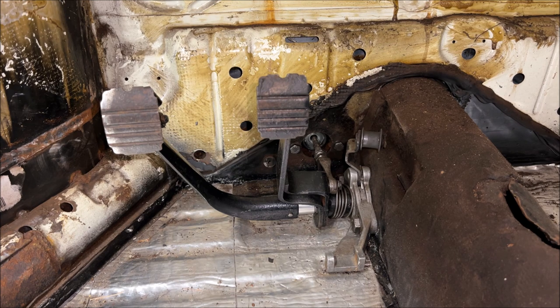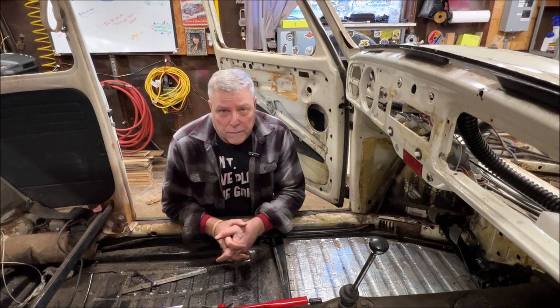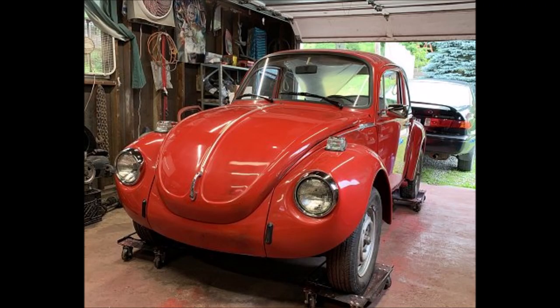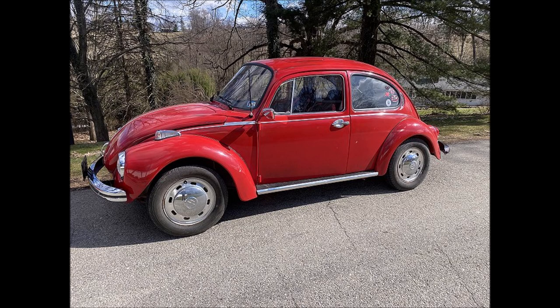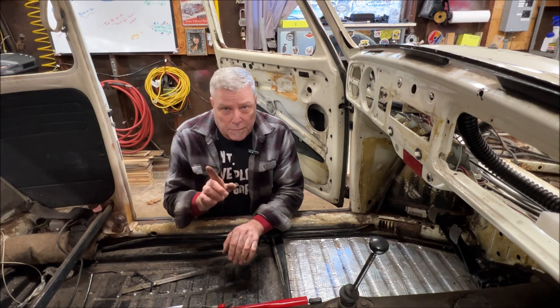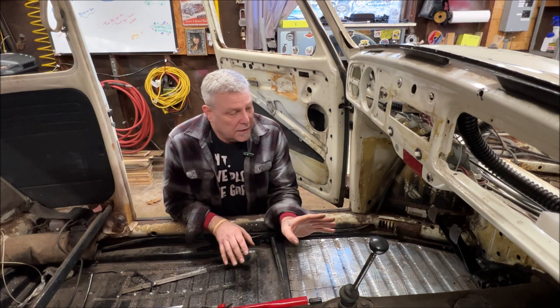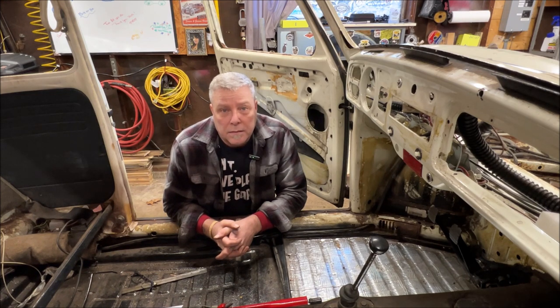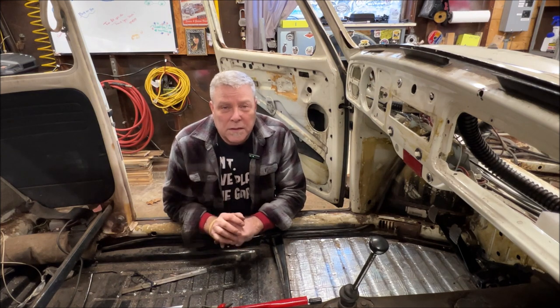I'm going to explain what happened to me — it'll take about one minute and you'll realize why this is crucial. If you recall my first adventure on YouTube a couple of years ago, I had the '73 Super Beetle. I went ahead and put a brand new master cylinder in it, tore the pedal assembly apart, completely cleaned it up, removed the pedal stop, cleaned the floors real nice, put all new brake lines on. I put it back together and I didn't measure the distance for the push rod. It seemed okay by feel, but I didn't measure it.